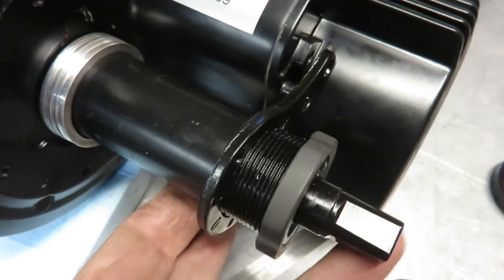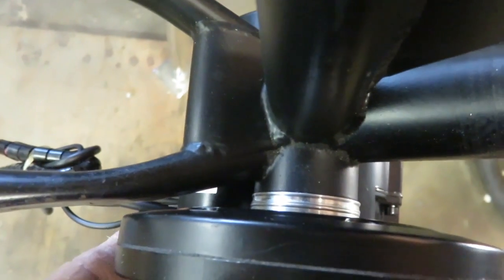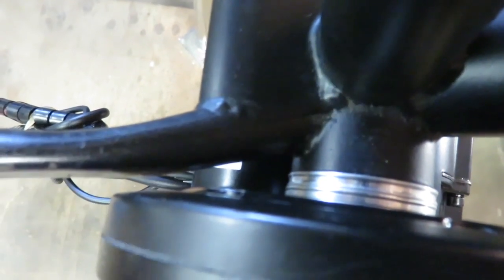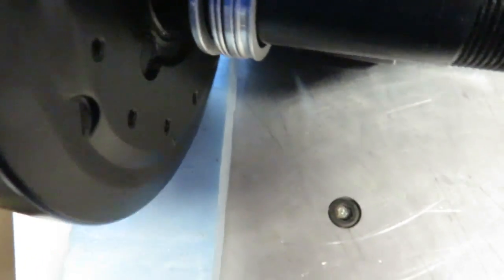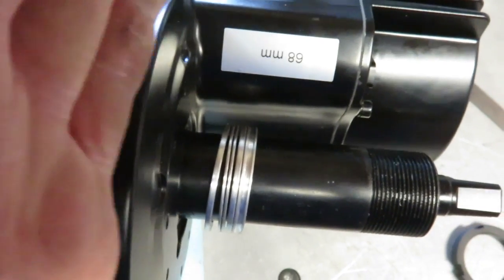I'm going to take these off now and fit the unit in the bike and check our shims. Now we can see the unit is in the bike, and there's actually quite a bit of space right here — plenty of room to function there. I had all the shims pushed up against it and it was too much. The clearance up here between the frame was more than it really needed to be, and I'm concerned about the chain line, so I don't want to move the unit too far away from the bicycle bottom bracket.